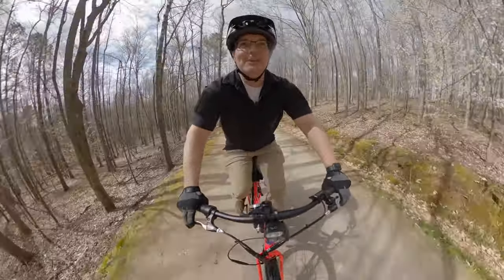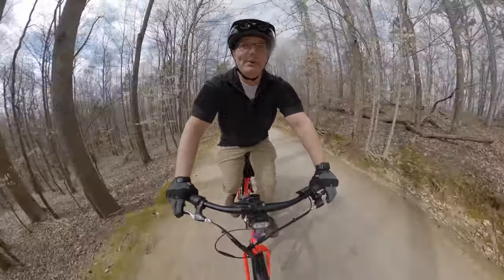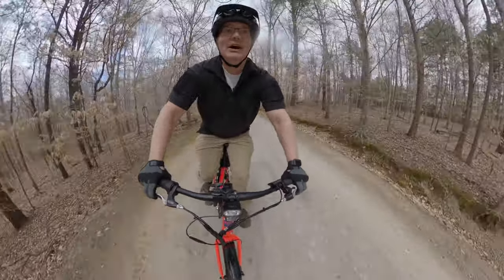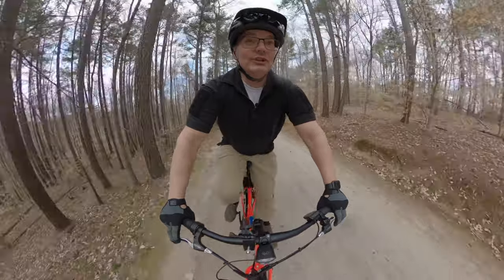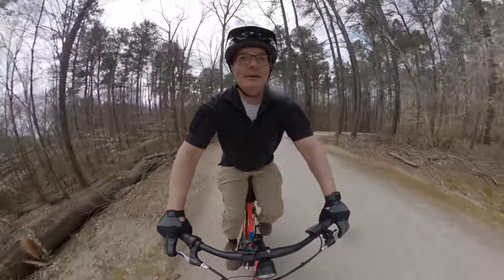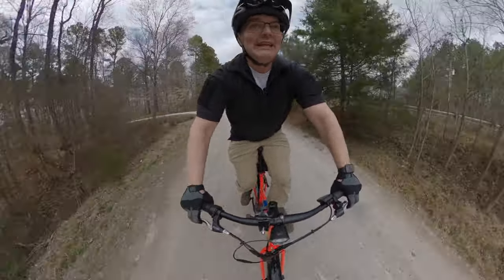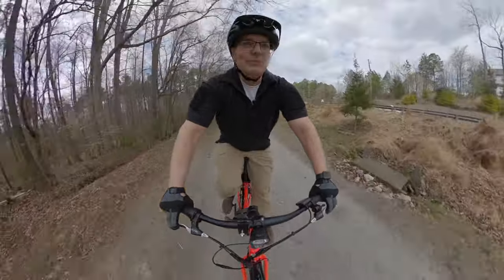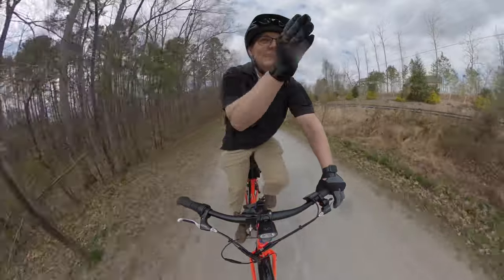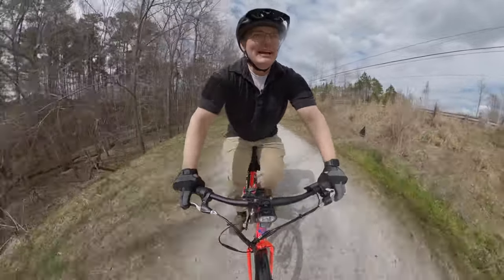One of the things that is really amazing about this bike is how quiet it is. The motor is so quiet, even compared to Rad's 750-watt peak motor or other brands' 750-watt motors. Additionally, because the chain isn't running through a derailleur but through a chain tensioner, it doesn't have to get pushed across different cogs. The sprocket in the back has only standard teeth — no chain lifting or dropping teeth — and those tend to be a little noisy even when you're not shifting. This drivetrain has no chain noise at all.